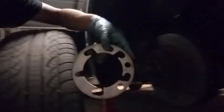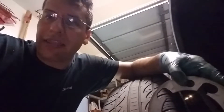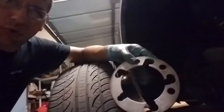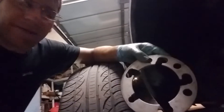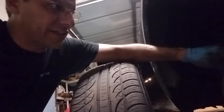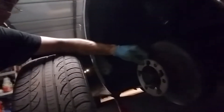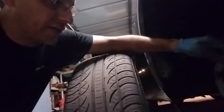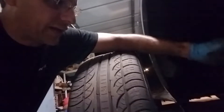Here's the spacer here. The key is that I needed only a quarter-inch spacer, because if I got a thicker spacer, the lug nuts wouldn't have enough threads to get on there. So I got a quarter-inch spacer that was made for 6-lug wheels, and I just had to trim it — you'll notice where I trimmed there are a couple of places to basically get the lug nuts to fit in the areas correctly.